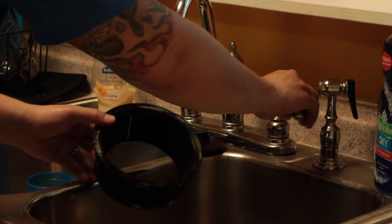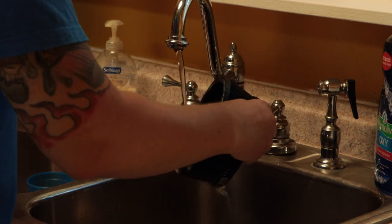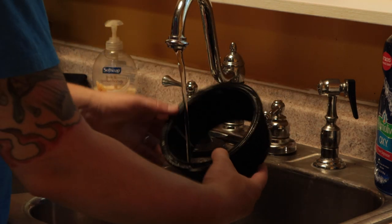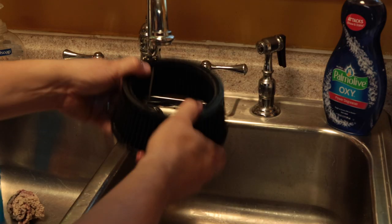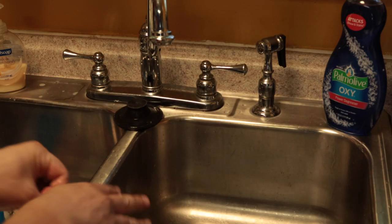After the 10 minutes, you wanna go ahead and rinse. Do the same thing — start from the inside and rinse to the outside, all the way around, until the water runs clean. It's also a good idea if you're gonna have your air cleaner off overnight: if you're drying it, go ahead and cover up your intake so dust, dirt, and debris doesn't get in there overnight.